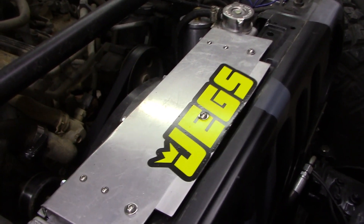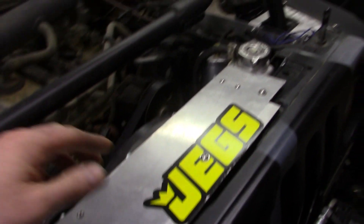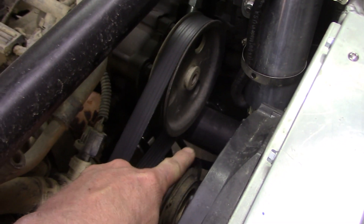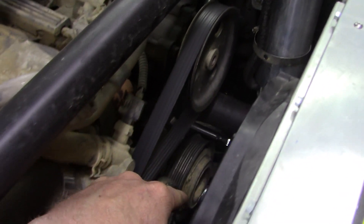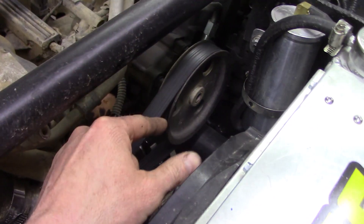The installation is complete, and it was actually pretty easy with basic hand tools. I went ahead and also installed an overflow tank, and hooked up the radiator hoses. I also did a non-AC belt, because that belt runs right between the pulleys — if I had gone with an AC belt like before, it would have been touching the radiator hose, so I got rid of that.